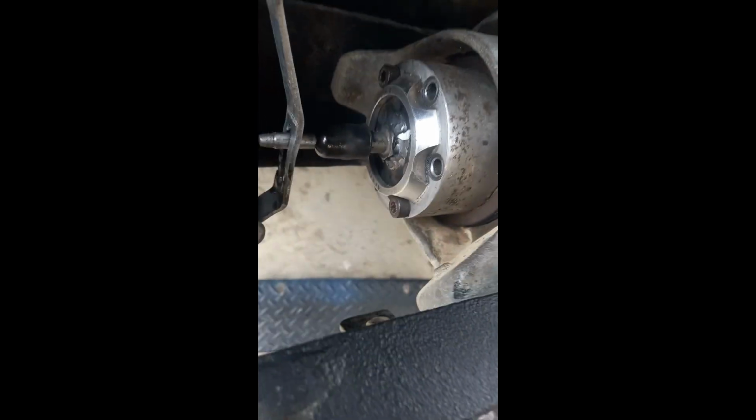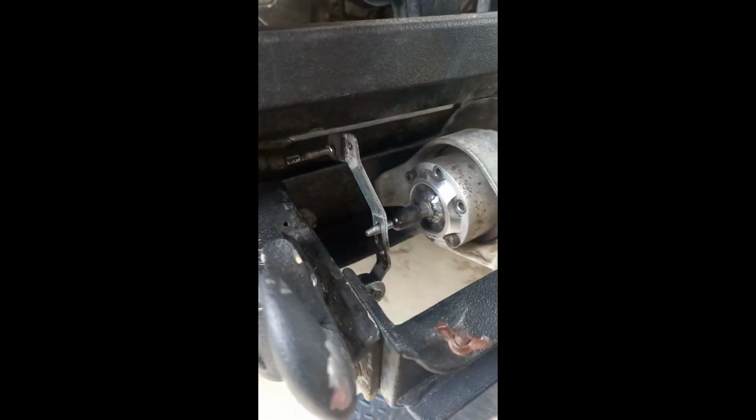So I made up that little fella down there, made up a pivot hinge thingy for it. I just got to tap the end of that thing. That plugs the end. Don't look at the welds to it. And then a foot on that thing. There, and this cable thing was the old sway bar disconnect, which I've never ever used. It's always been tucked around the back and along the chassis. So I just unclipped it and pulled it up the front. So it's like on a handbrake lever right next to your left foot. You just pull on the lever, Freespool. Really good.